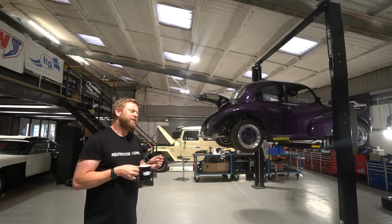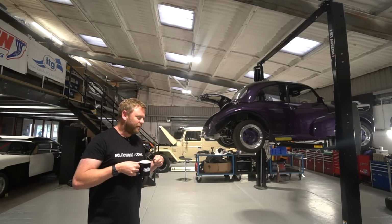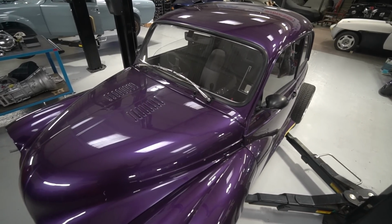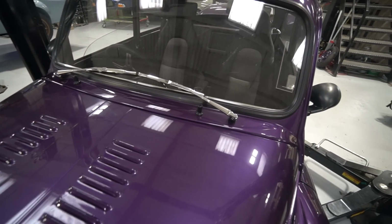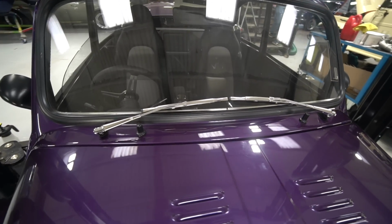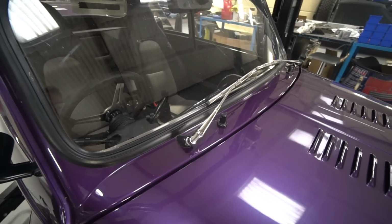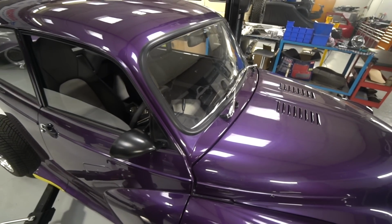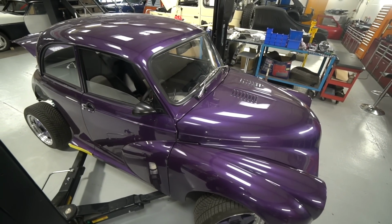So we were looking at the other type of Tex wiper arm that's actually got, I think they call it a bayonet fitting, but it's kind of the wiper arm actually clicks into a socket quite positively. And we were thinking it makes much more sense to use those because they do the same length wiper blades with that system, and they can do the wiper arms. Now I believe possibly on the later Morrises they do actually offer that style, but not on the clap hands. And I was thinking, well, the only difference is that one's cranked one way and the other's cranked the other way. And I know that Tex offer right and left hand drive arms for a lot of cars, so it kind of made sense that there just needed to be an arm that was the right length, one cranked to the right, one cranked to the left, 10-degree crank on them, and the appropriate size blade.